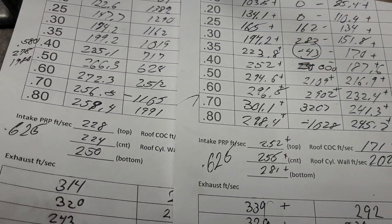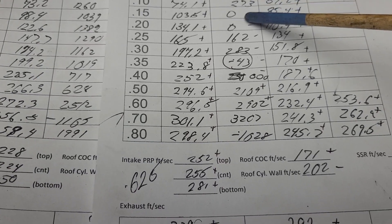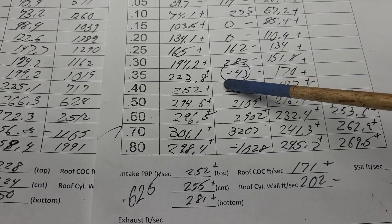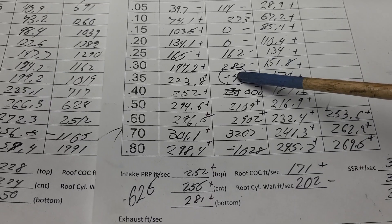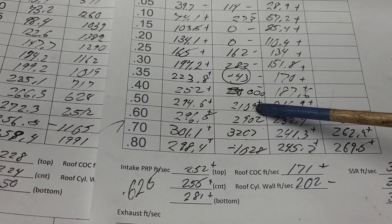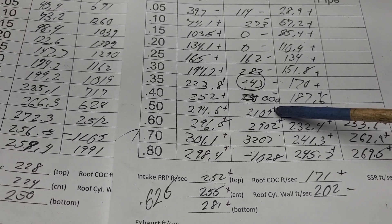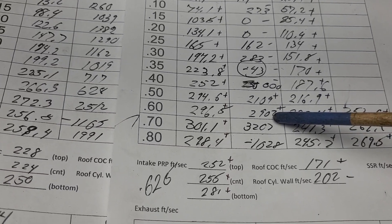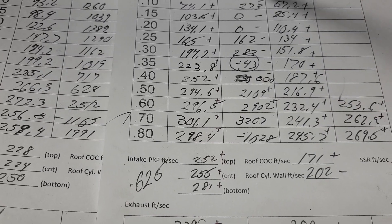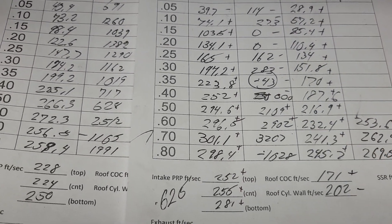Very interesting on the swirl though. Take a look at the swirl curve here — I like the swirl curve. Completely different here. We actually have a reversal at 350. I'm not thrilled with that, but I don't know if that would hurt it at all. Because at 500 it starts skipping off the short side radius and bangs it with a lot of swirl. And by the time we're right in this area we've got more than we need. So relatively lazy with swirl and then hitting it — that works for me. I like that setup.